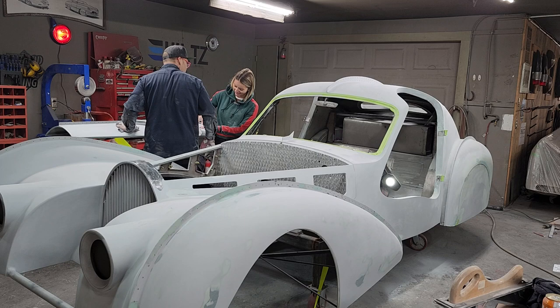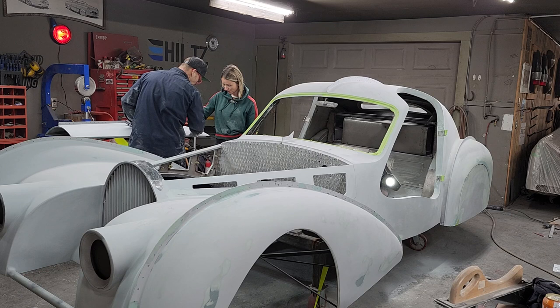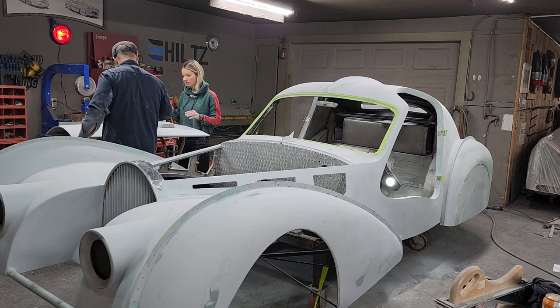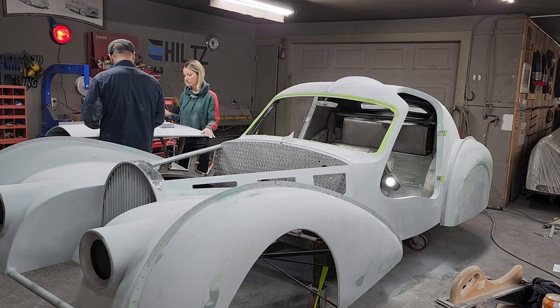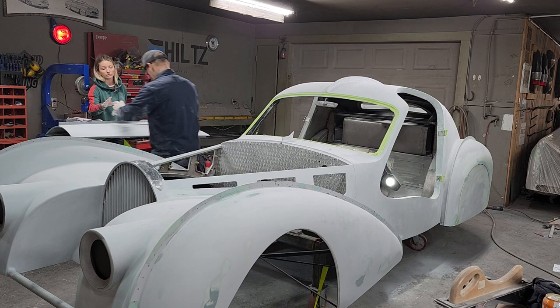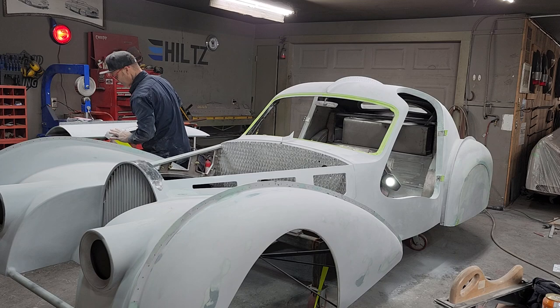No, look. Here, I'll take a little. Alright, let's get all the center. You got a little one right there. I would use a long board on that. Try to keep taking that down so you get that. Once you get your camera, show what you have and what you need to get. You can show that spot and a couple of spots there. So you're gonna long board that whole thing. And you're not gonna really press on the board real hard, right? Jolene, you're going to let that sandpaper do its work.